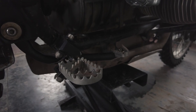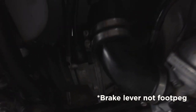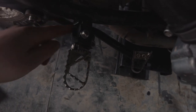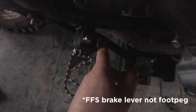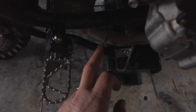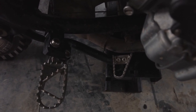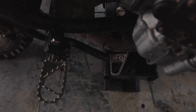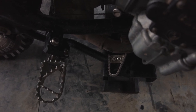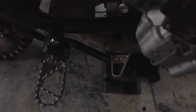There are some considerations if you go down this route: the original foot peg will now hit the new bracket, so you have to bend the foot peg inside the arrangement. Just be aware there is some further work to do with your brake lever. You can speak to Baz at Hyperpro and he will do this for a small fee — if you send him the foot peg he'll sort it out, do the welding, and you just pay him a bit for his work. He's super friendly and easy to talk to.